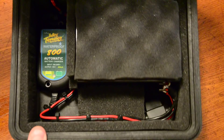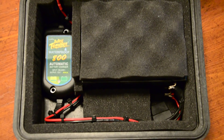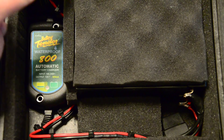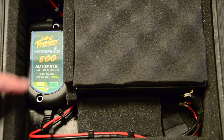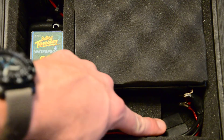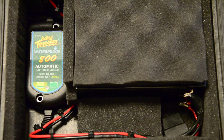Let me show you how all this comes into play. From here you can see the wire coming down — it goes under this foam and connects directly to the battery. The battery tender is coming off going under here as well. It has an inline fuse box right there, and I've soldered both of these connections to give it a better, more stable connection.